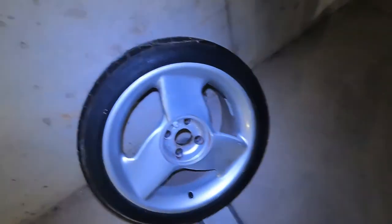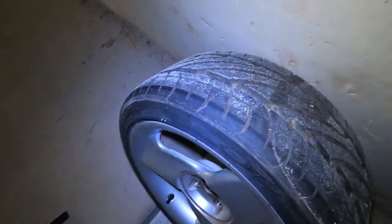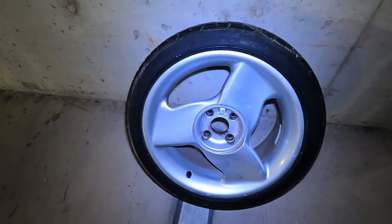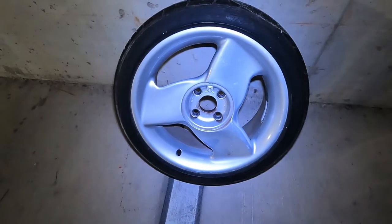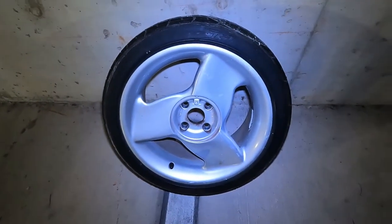And of course these tires — they are a bit too big. Unfortunately there's no stretch. They're a 205-40. I love this wheel so I really don't want to get rid of them, but I've got to run a smaller tire because of the offset if I want to be somewhat low. I'm going to go ahead and get these on.